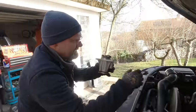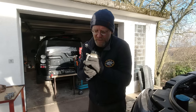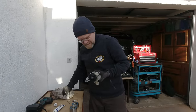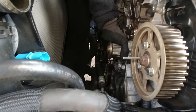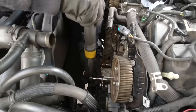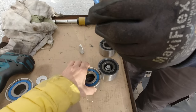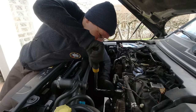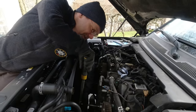If the pump is not weeping, it's not leaking — there's a special weep hole. It feels good, it has no play. Putting on some silicone grease, and the used pump goes back in because it's still perfect. Two brand new pulley wheels — put some Loctite on so you can't confuse them. They do get torqued, of course — 46 newton meters. And now the extension does not change the torque — this is still our favorite desktop mechanic comment.